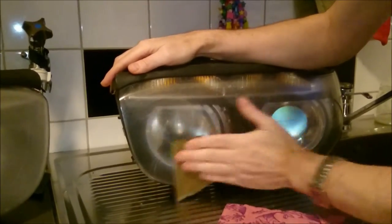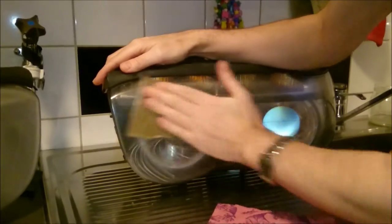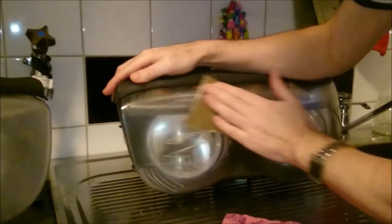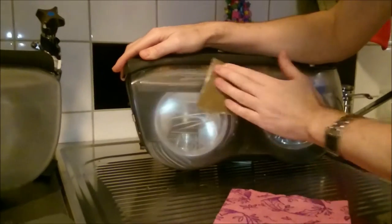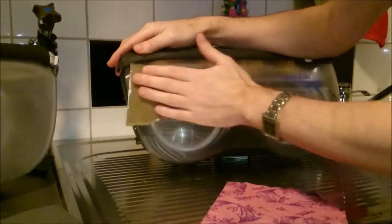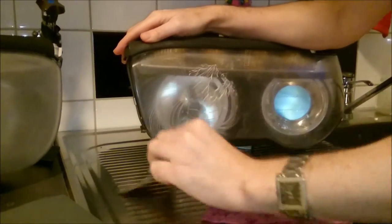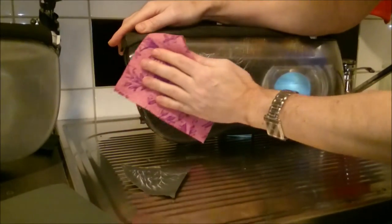The trick with removing all the small scratches with 600 grit paper is that when you put on the clear coat they will be completely smooth. This is the prep work for the clear coat, and if you don't do this as well as possible you will have a bad end result.